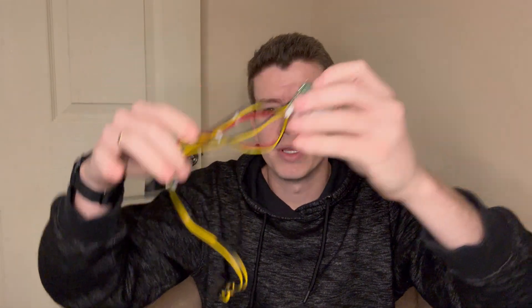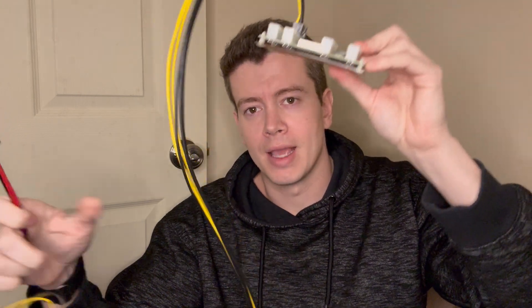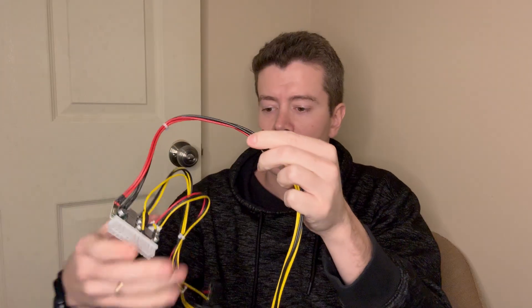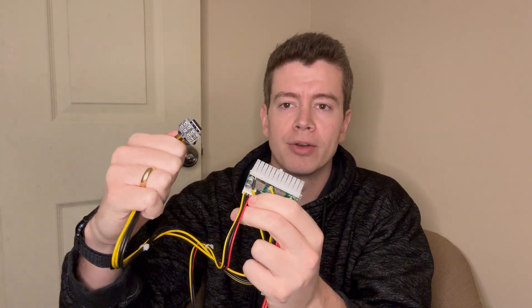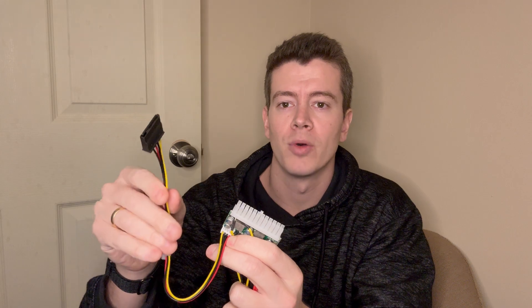So what exactly is a Pico PSU? Basically it's got one input power pin right here and it's a standard PCIe 6-pin. What you do is take your standard breakout board with a PCIe cable and plug that PCIe cable into the input power on the Pico PSU. The Pico PSU has a motherboard connector to power the motherboard, an 8-pin CPU connector to power the CPU, and it also comes with a little SATA cable to power your SSD that has Hive OS.